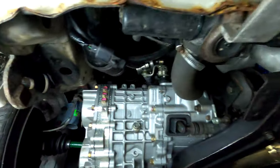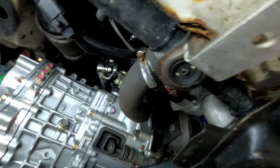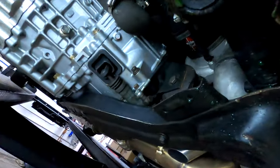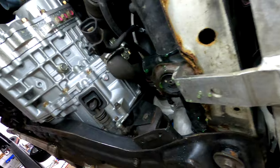So yeah, I'm gonna get the coolant out, pull the radiator, and then I can have access to the condenser. Nice and green coolant. Doesn't seem like there's any kind of leaks or head gasket issues or combustion gases in there. Nice dark green. I think I'm gonna get new coolant though and kind of flush it out when I do it. Just might as well. So that's done. Now I gotta pull it from the top and wiggle it out of there.